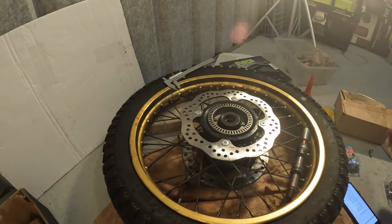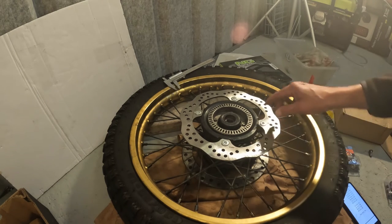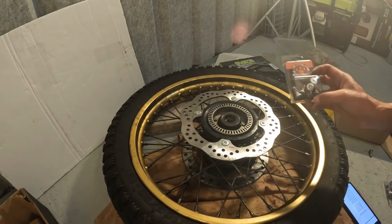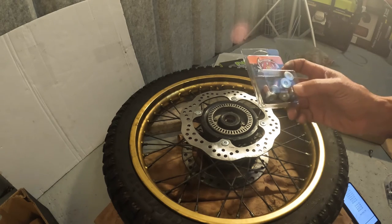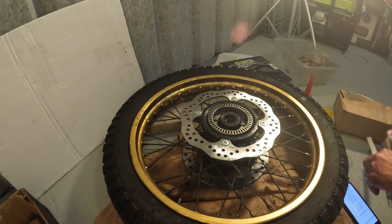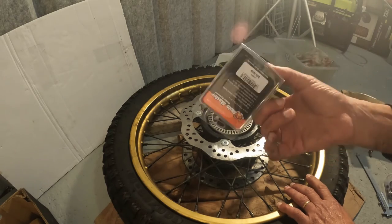This one is installed; we're going to do the same for the back. The torque is 31 foot-pounds or 42 Nm. The screw, as I said, is for the CRF 250 — M8, 22mm in length. These are very hard to find here in Europe right now. I'll put in the description where I got this one so you can have a look.